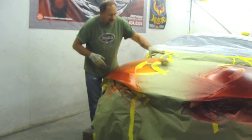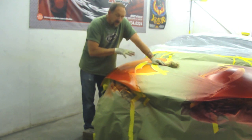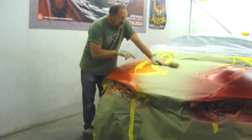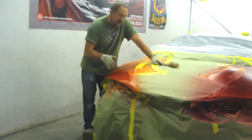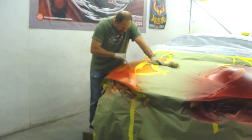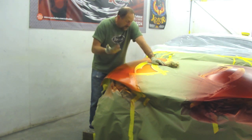As you can see in the camera, what I just showed you is way too dark. The reason is I originally sprayed this like three years ago with a candy concentrate and it's died back. That is the correct gold. You can see on the edges — candy concentrate will die back and that's what happened. I should have used a candy base coat. I didn't have any when I did this, and that's what will happen down the road: it will die back, it will fade out.